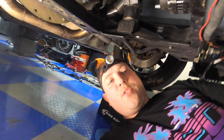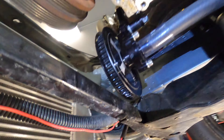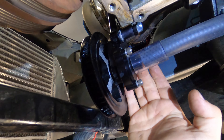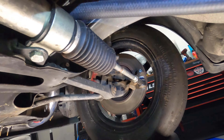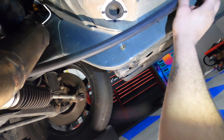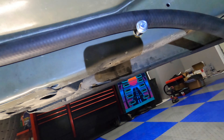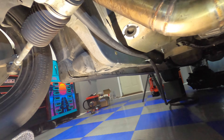We're under the car and it looks like it's going to be so easy it should be against the law. I just used a little piece of clear hose because it's bigger to hold the black hose — we got it going here with a small little bend. That's not a very sharp radius at all. I just got it resting on this bolt right here. That's a pretty good shot to the back of the pump — clears the motor mount. That's less than a six-inch radius for sure — I wouldn't even have to measure that.